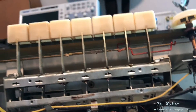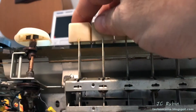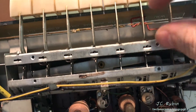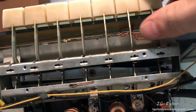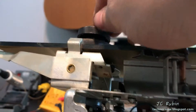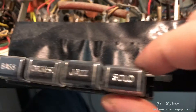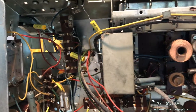I've taken off this section to gain access to do so. While I was there, I was able to lubricate this system. The off switch was getting stuck, so when you would turn it on you would have to push it down several times to shut it off, and this crossmember here was seized — now it works really nice. Everything here has been lubricated. The internal switches got deoxid, so did these two controls, the volume up here, some of the areas on the knobs, as well as this one down here.